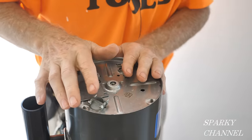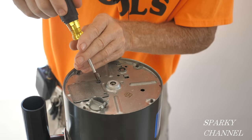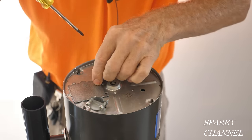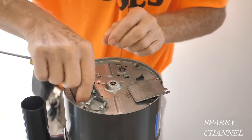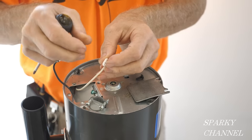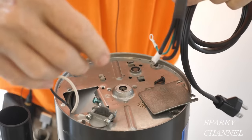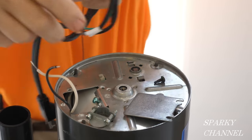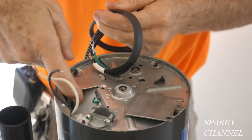That makes for a good connection to the garbage disposal. The next thing is to take off this little plate — one screw takes it off. Then pull out the wires: you've got the hot black wire and the white neutral wire. Take the cord — it has a nice curve to it, which is what you need. You want it to curve and come out here; it goes in here and comes out here.